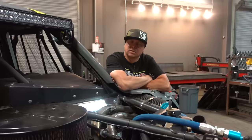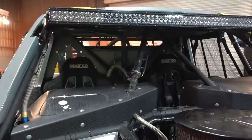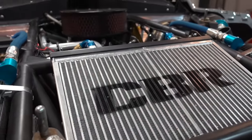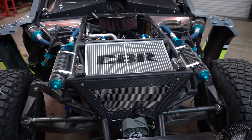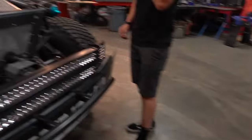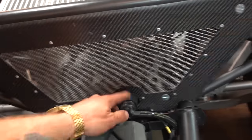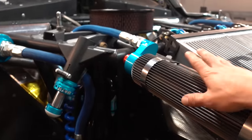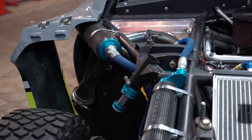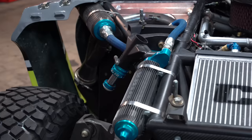Water pump is mechanical this year. Really nice finish panels — all carbon. And really nice wiring: all mil-spec, Raychem. Keeping the shock reservoirs up here keeps everything cool — all fin reservoirs. There's a lot to think about, but kept below the body line so that if somebody does roll, it's not wrecked and they can keep continuing the race.